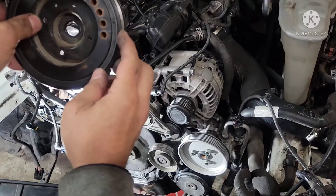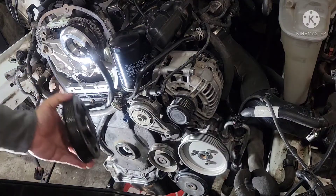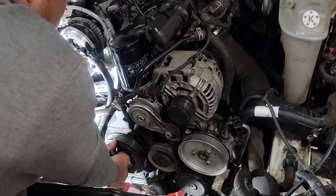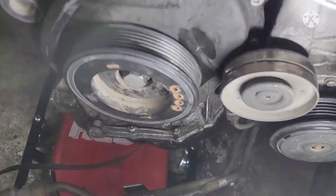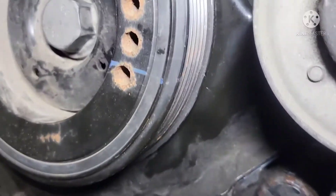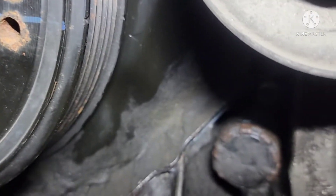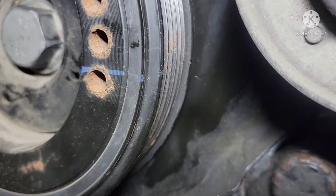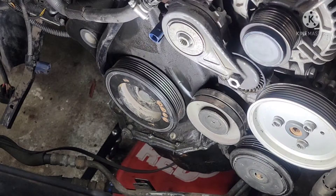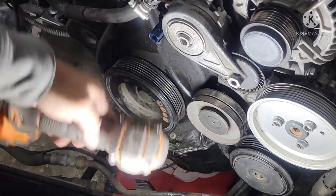Then the mark right here is at about 3 o'clock. Alright, let's put this pulley in here and check the mark. Here's my marking right there on the oil pan, on the timing cover, to the crank. Alright, we're going to snug it up — I use a 15/16 socket here, just snug up the crank bolt.